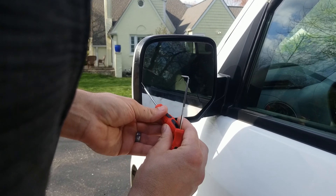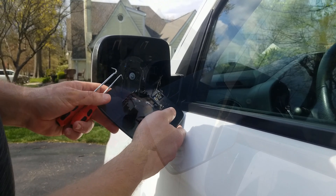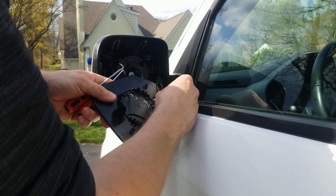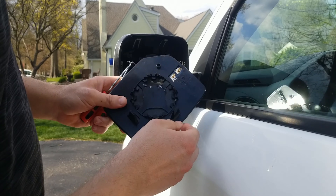These picks make it a lot easier and they're super cheap — you can pick them up for next to nothing. What we're going to do is position our picks back behind the mirror on both sides, grab the end of the glass, and pull back on it to pull this out of here. Then we're just going to rotate it over and disconnect the leads to our mirror, because the mirror on this 2009 to 2013 Honda Pilot is heated.